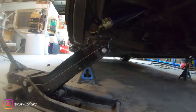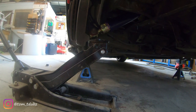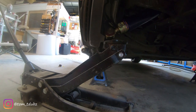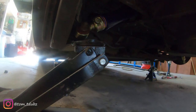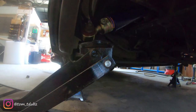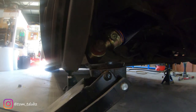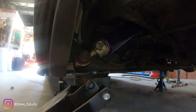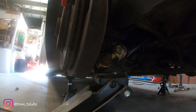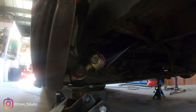What I've done here is simulate the van going over a really bad pothole with the suspension going up into the arch — so the wheel's gone right up, everything compressed as much as it will go. This is to show you that at the moment I don't need the chassis mod, so I don't need to trim any of my chassis away — I've got plenty of clearance. This is still on the Stance Plus springs but obviously introducing the Gaz shock. If I were to go to a smaller spring like the Gaz ultra low kit or even one of the big expensive brands, then yes I probably would need a chassis mod, but for now I don't.